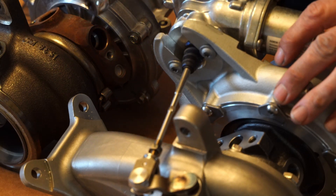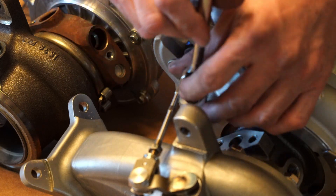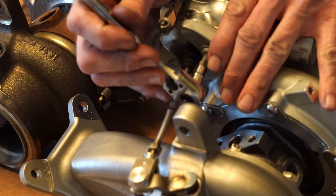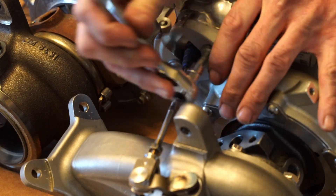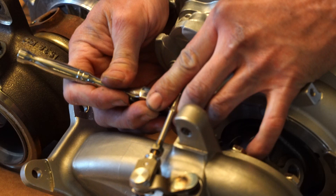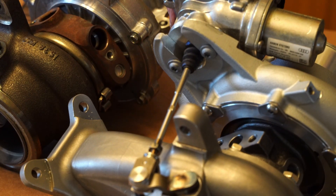The issue with the IS-20 style actuator is you normally would want to check voltage with the turbo installed and the engine running. But I don't want to do that because I don't want to wait to install the turbo to adjust the wastegate, and I certainly don't want to have to reach back there and do that adjustment with the turbo installed.